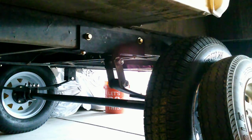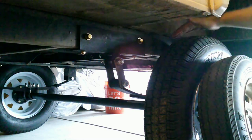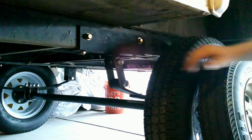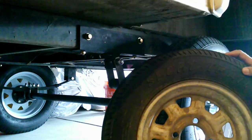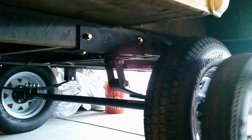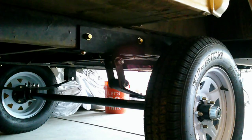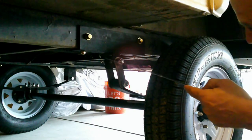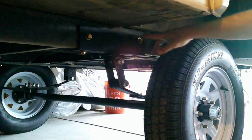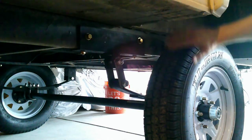With the original independent axle, it only let the tire down about an inch or two, and you can see those original tires are pretty small — I think they're about 4 inches shorter than the ones I have now. We welded everything up and made sure the tire was nice and centered. Then we drilled 4 holes in each side and bolted them in.